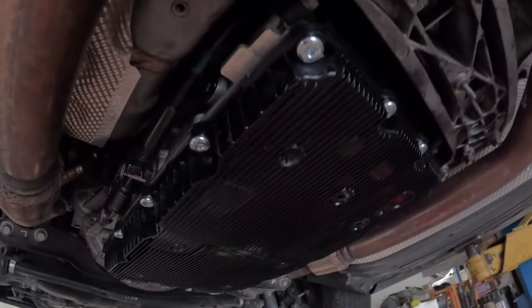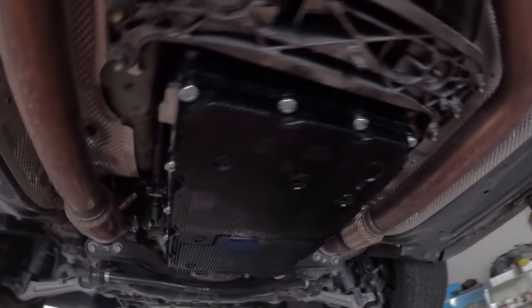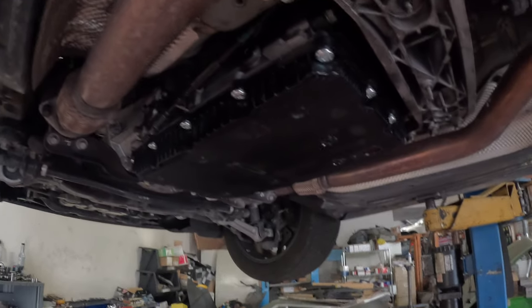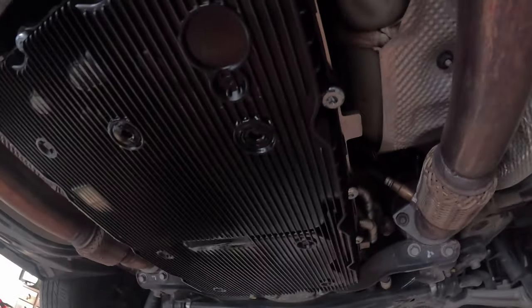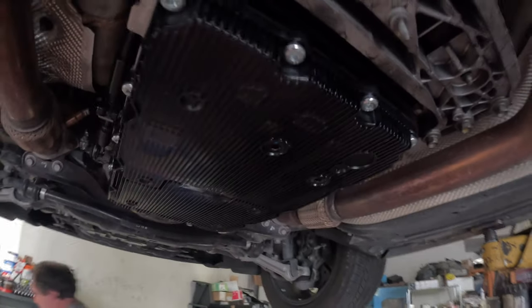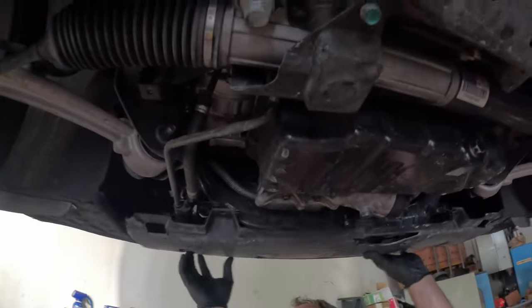And that's pretty much it. Once you're done, this is going to be pretty hot, so you want to move as quick as you can. The fluid temperature has to be between 122 and 140 degrees — Jeremy is a perfectionist — it is between 122 and 140 degrees that you need to have the temperature of that fluid before you can fully fill everything. Once you're done, bolt everything back up, bolt your fill plug back in, put your leveler back in and tighten that up. Put your beauty plates and plastic panels back in, and it is a wrap.